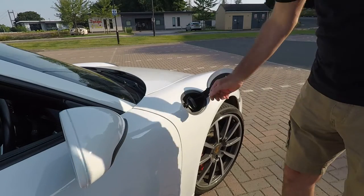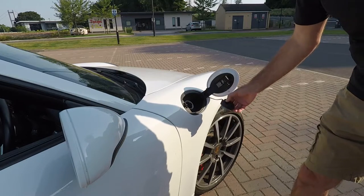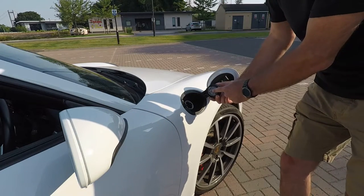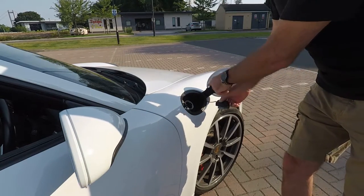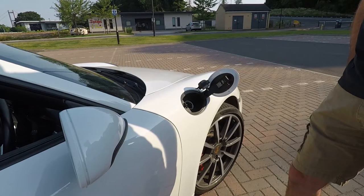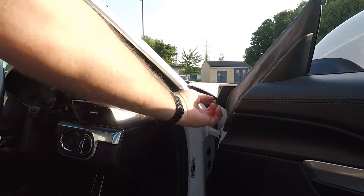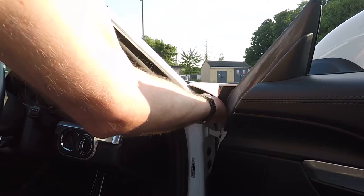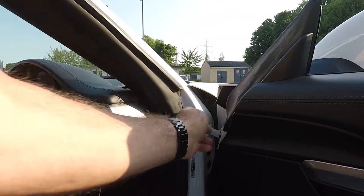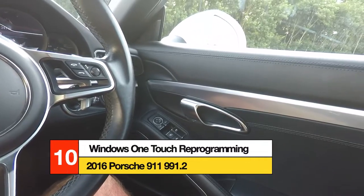When you come to fill the car with fuel, a lot of people just leave the filler cap dangling and rubbing against the bodywork — don't do that. The older 997s used to have a little hook for the cable; the new models now have a pin shape on the end of the cap, and there's a hole in the hinge where you just place the filler cap whilst filling. If you find you cannot open the fuel flap because it's jammed, just underneath this part of the wing there is a little toggle which you can get your fingers on, pull it out, and that will release the fuel flap for you.